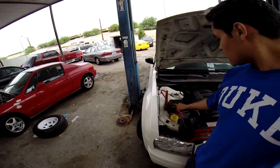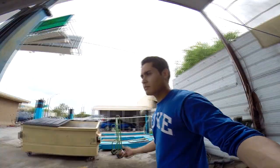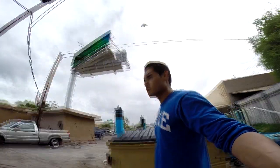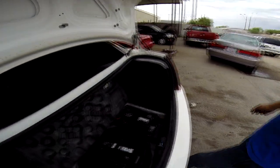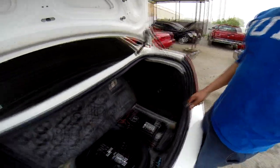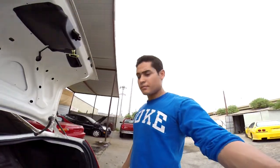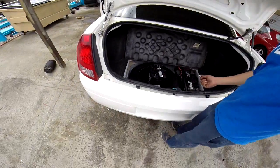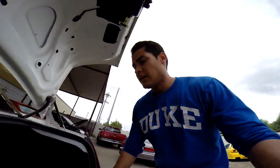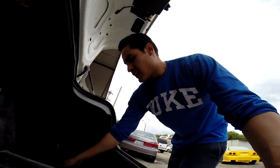We have little places where you can put your jumper cables. So that's done — just open it normally. You're going to hit the button like you always do to open the trunk, or you can use your key. Once back here, it's the battery. It's a huge battery. Mercedes and BMW tend to use these batteries. They are the 94Rs. So you can use another common replacement — it's a 40R. A lot cheaper if you don't want to spend the extra $100 on the bigger version. It will work just fine.